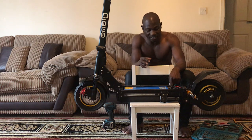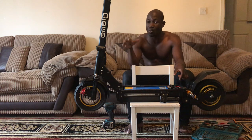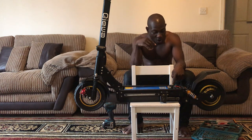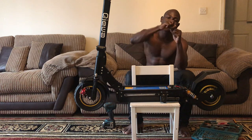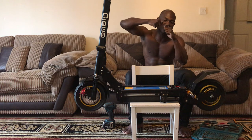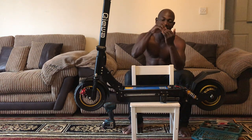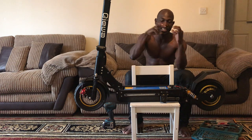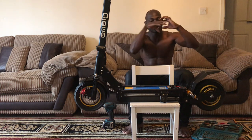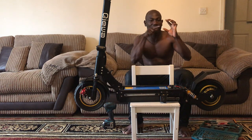One thing as well I need to mention is that what Qiewa did here is that because they want this to be very water resistant, I realized that when I opened all the connectors, they put some jelly silicone there when they connect the clip in. The reason they do that is for the silicone to seal the holes, because the connectors have cables that are interlinking into some smaller socket inside. And those holes are there for the cable to pass through.